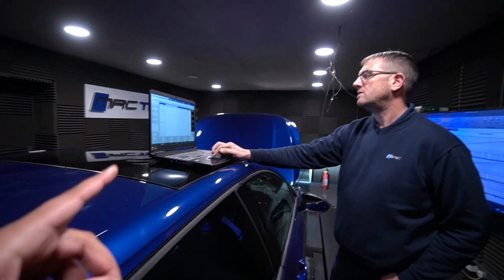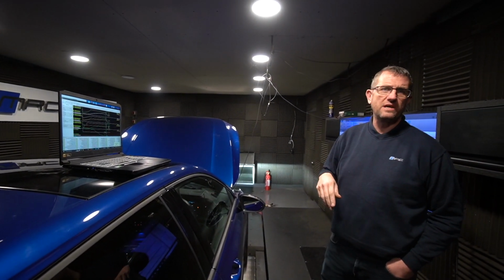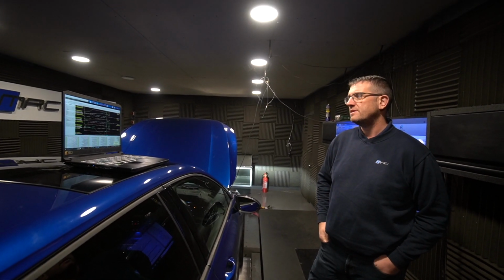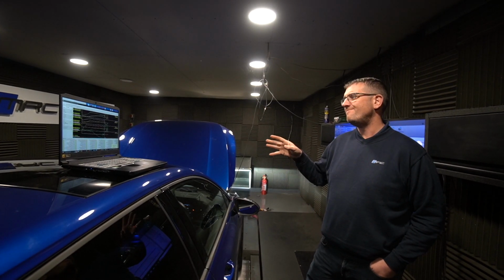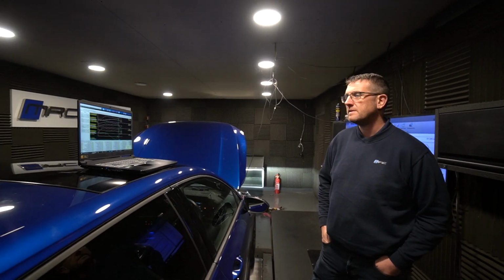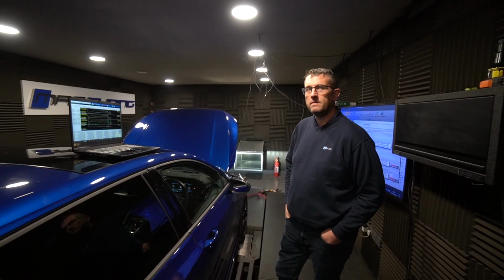In terms of a comparison of those sort of numbers on the 7R, what type of hybrid would you have to run? It's all the larger compressor, stock shaft hybrids, like the 450 spec turbos. It's pretty close to what they would do. They're sort of 450 to 470 and then 460 to 500 on octane booster, so you're pretty close to that. It's also making sense as well with the exhaust factor in the prior video where we were talking about how it just got us so much more just by changing even the cat back out.